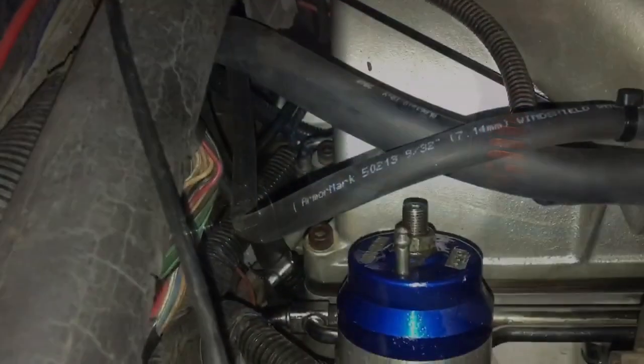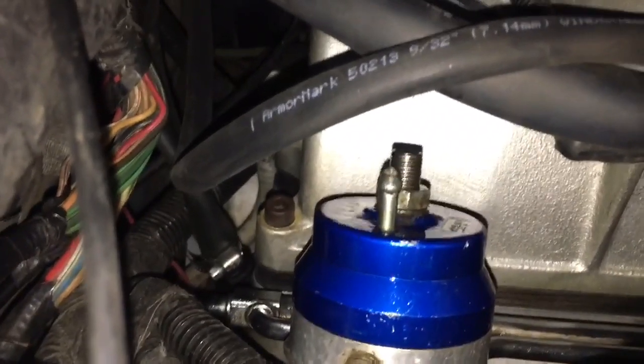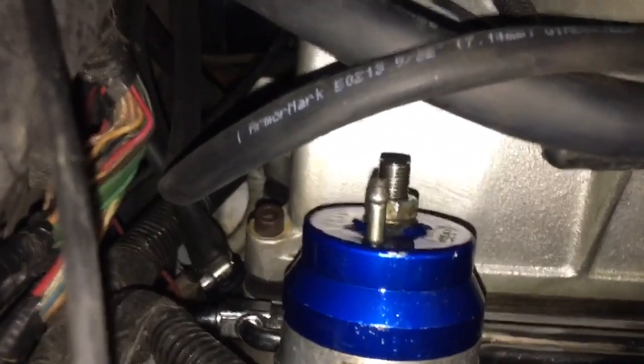Sorry it's so dark. It's been doing this idle surge for about 10 minutes now. It hasn't died, which is awesome, but it's not too happy. It's really too dark to tell, but it's smoking a little bit too, so I think it's running rich. I'm going to pull a little fuel pressure out of it. That is my clue — the regulator's leaking. But hey, we found the problem — it's always good.